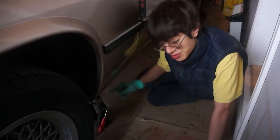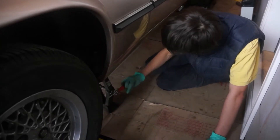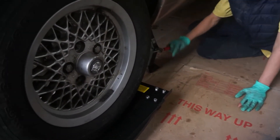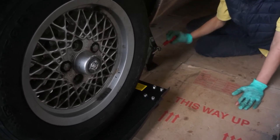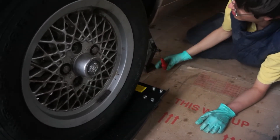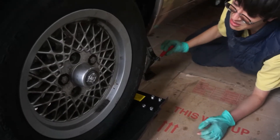So now we've got the rear jack, which is actually from a Toyota Corina, and we're going to just slowly let it down. This will then leave the wheel much closer down. The idea is when you're on these trolley jacks, there's obviously a lot of weight from the car — if you can try and get the distance from the wheel onto the dollies as low as possible, then it reduces any chance of damage.